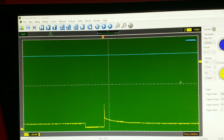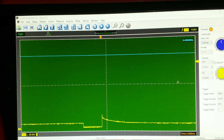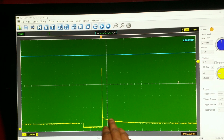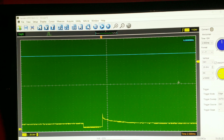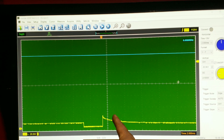Alright, I'm back to that cylinder which I suspect is not doing its job. Looks like it's trying to make the voltage for the spark, but for some reason it's not showing us a typical ignition picture. Just by looking at that picture, I know the coil is bad, and we need to change the whole 4 coil block because I can't pull it apart to fix it. So we got no choice, but just by looking at this ignition waveform, I can tell this coil is bad. I really need to see what's actually happening inside that coil, but to me it looks like it's shorted internally because it's making a spike, making its voltage, but it's not firing into the cylinder.